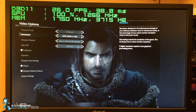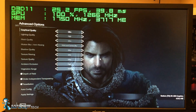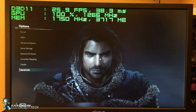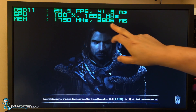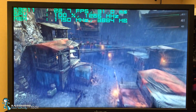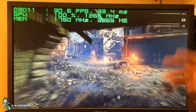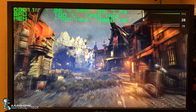We'll go into options to show you: the video is set to 200%, so it's essentially running at 3840×2160. Under advanced options we have it on ultra, to push the memory needed. Over here you'll see it's showing 4352 megabytes. We're going to run the benchmark for a few seconds — what we're focusing on is memory usage. We're getting up to about 3800 to 3900 megabytes, and I'm using plus 50 on the power limit, holding full clock speed at 1266 MHz.